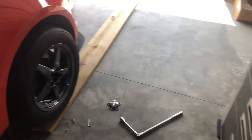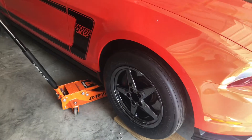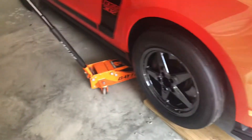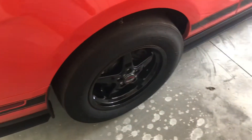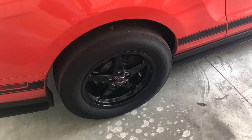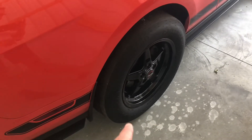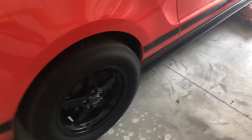As far as the quality of these wheels — honestly in my opinion they're junk. I'm only using them because I got a great price on a Black Friday deal and I have them; I'm not spending any more money. We'll use them — if we have vibration issues that's another story. If I cannot get these 17s to work, we're going to set up some 15s — probably a 15x8 — and see if that works without having to move the rear sway bar. I don't want to physically cut on the Boss 302, but if we can get it to work awesome; if not, we'll go to a 15.